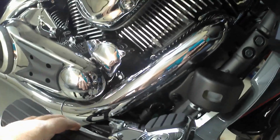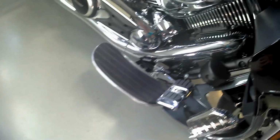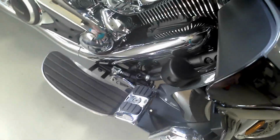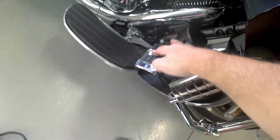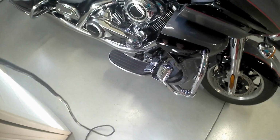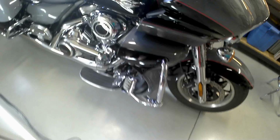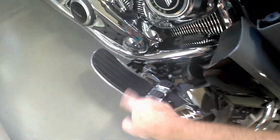Let's go ahead and get the pad on there, and then we can see how it looks. So really, so far, the only thing I don't like about this is I wish this could have gone on the other side, the actual opening. If you try to flip this around, nothing lines up. So you have to do it this way. And again, this bolt here being a little too long, so you have to come up with your own extra washer and lock washer. And make sure it's all stainless, guys. You don't want to be putting stuff on there that's going to rust. So anyway, I say about the orientation because I just kind of thought, shoot, I didn't even try that. So I took it off, flipped it around, nothing lined up, had to put it back on again.